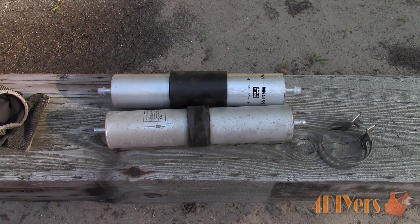Not all vehicles are equipped with a replaceable fuel filter unfortunately. Some, like the one I am working with here today, have an external filter that is required to be replaced at certain maintenance intervals. Others have a built-on fuel filter that is part of the fuel pump assembly and can be very costly to replace. Normally that style is only replaced when the fuel pump fails.